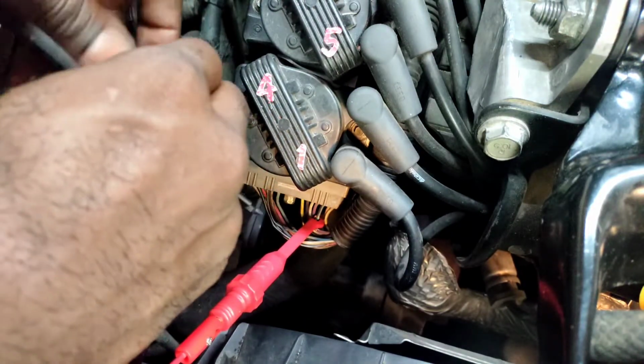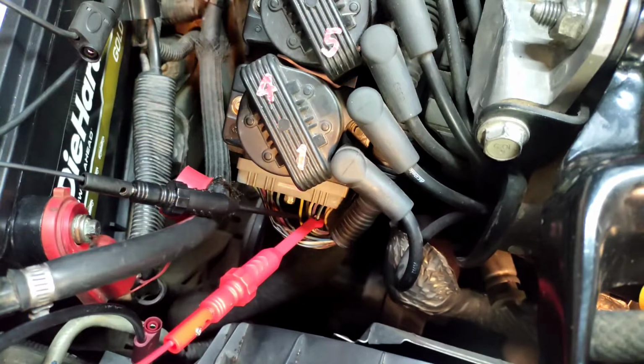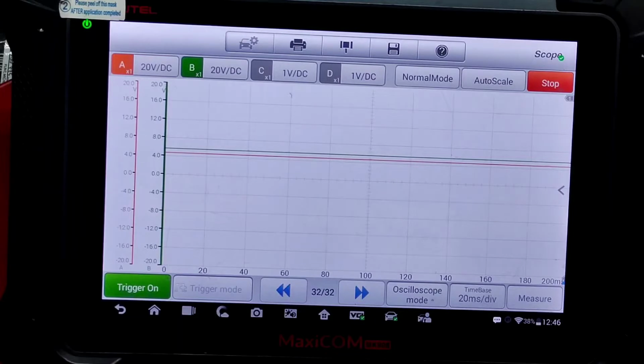Uh-oh, totally missed that one. All right, let's hook up the oscilloscope and look at the values. I'll remove that glare so it'll help. So we hooked up on the inputs and outputs of the 18X crank sensor. And I'm just removing one of the pins. The yellow wire, which is terminal G on the ignition control module, is going from the crank position sensor to the module.